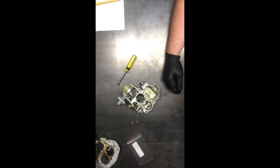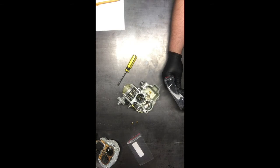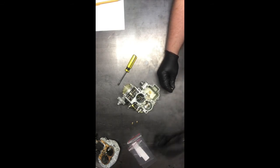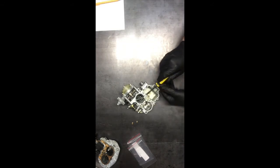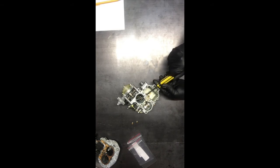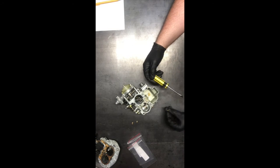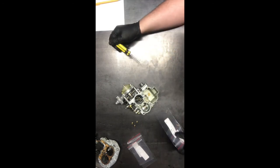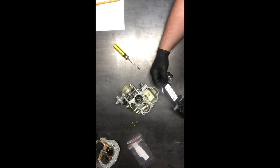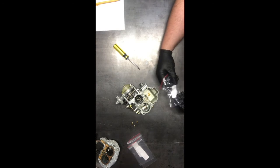We had a 137 from the factory. I'm going to drop mine down to a 125 because I don't want to go too low — I still want to leave some adjustability with the mixture screw. My mixture screw was completely unresponsive with the original jetting. At the end of this video, after I put it back on the car, I'll let you see what the air fuel ratio is after all this, and then we can extrapolate whether or not we went the right direction with these jets.